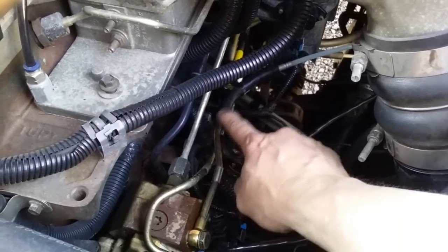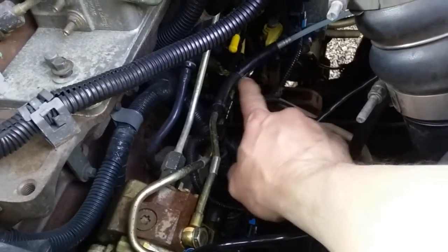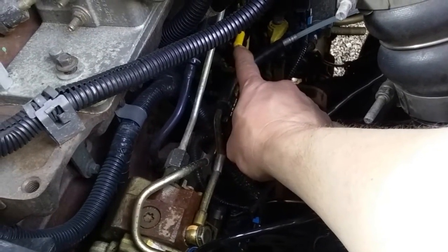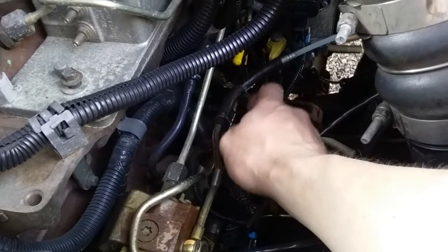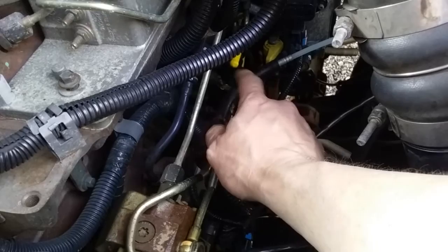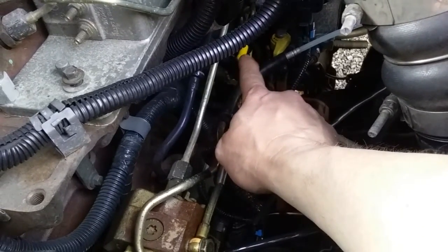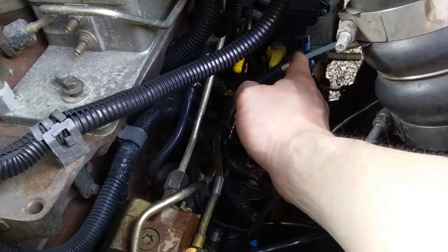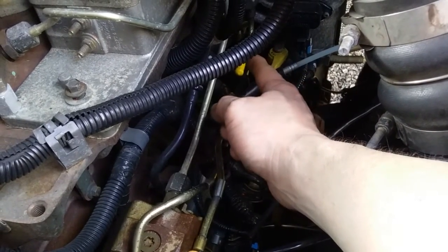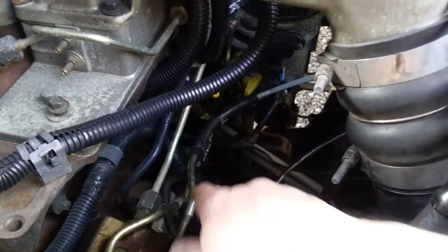We're connected to the injector return. We have separated it out from the other returns to be independent. We've got the existing line capped off. This comes from the rail pressure relief valve. We've already verified that it will withstand the testing pressures and not contribute to what we're trying to measure, so it's only capped off just so the return coming out of the injector return line doesn't actually run out here, because it has to push it through a flow meter. It takes a little pressure to do that.